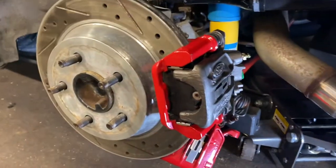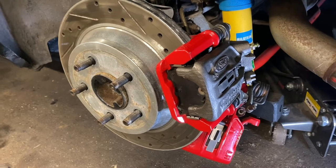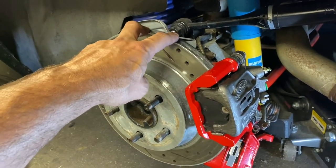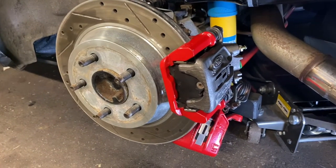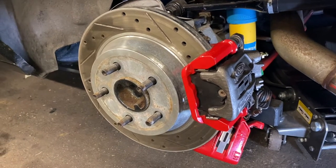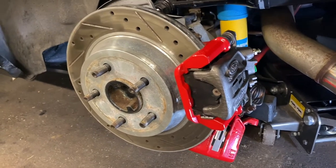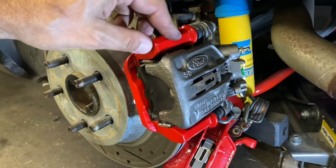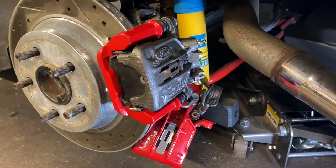You could do this with the GT brakes, but if you're trying to get more rear bias I don't know why you would use a smaller rotor — you'd want the larger rotor. Bear does make a 13 inch rotor kit for this; I believe it uses the GT/V6 brake setup with a spacer, and I believe those rotors are thinner so you could use the GT/V6 abutments or the abutment that comes with the Taurus caliper. But for the sake of this video I'm assuming most folks are going to use the Cobra setup: Taurus 43, Cobra abutments, Cobra pads, Cobra rotors.